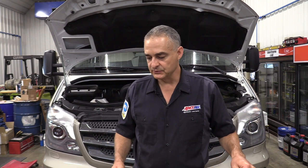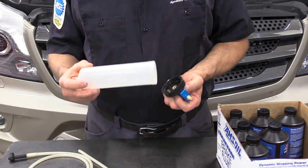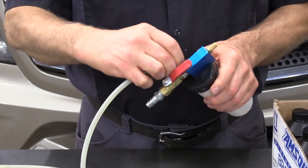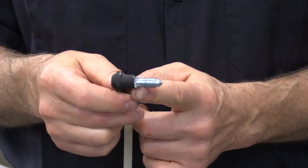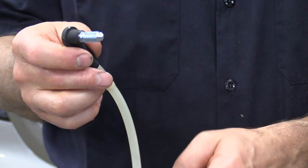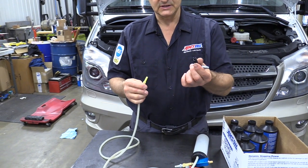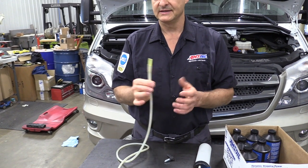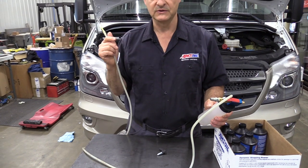We're going to do this brake flush and I've got a tool I want to show you — I'll put a link in the description. It hooks up to compressed air and is a little vacuum generator with an O-ring seal that captures the fluid. We have a hose that goes on, and we create a vacuum. This snaps onto the bleeder. We open that bleeder maybe a quarter to a half turn — you don't want to go too far or you start sucking air and you'll see bubbles. First, we'll pop off the adapter, go to the master cylinder, and suck out as much as we can before adding fresh fluid, so the flush doesn't take as long. Then I go to each wheel and work my way around all four.